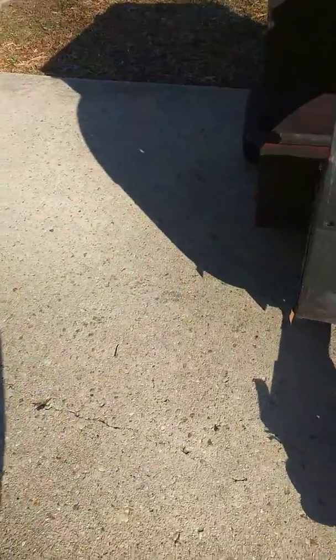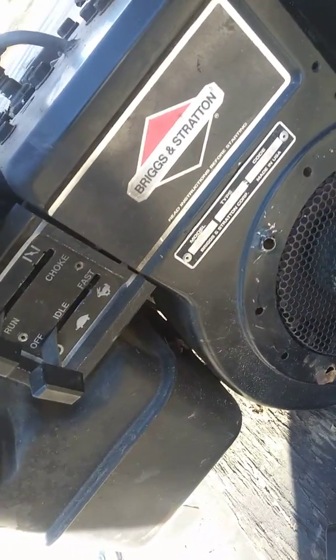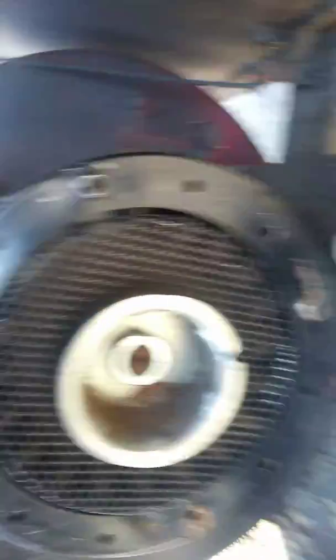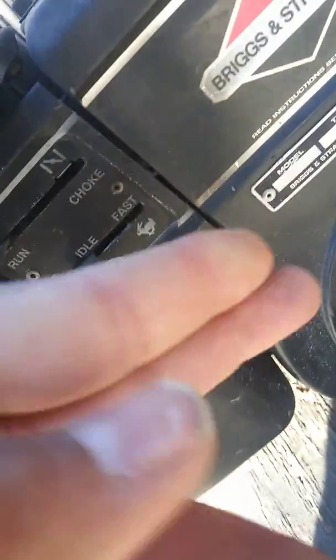But I'm not going to do it that way. Overall, I paid a couple hundred dollars for this — good deal. It runs great. The only other problem is when I go to wrap the pull cord around it, this piece tends to slip and I do not like that. I'm a little worried. I was thinking I can get a bolt or put it on a socket and spin it over my drill. But yeah, I wrap it around, put it at idle, then put it on choke, pull it, it'll start up, then I put it on run.